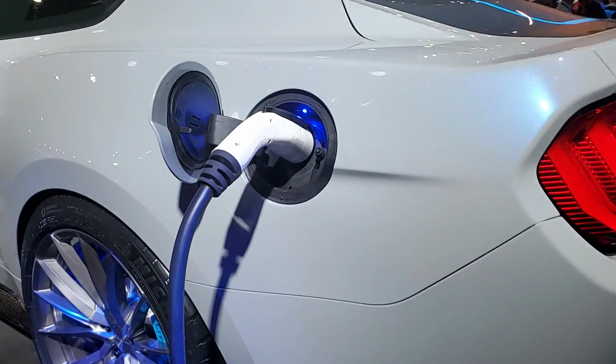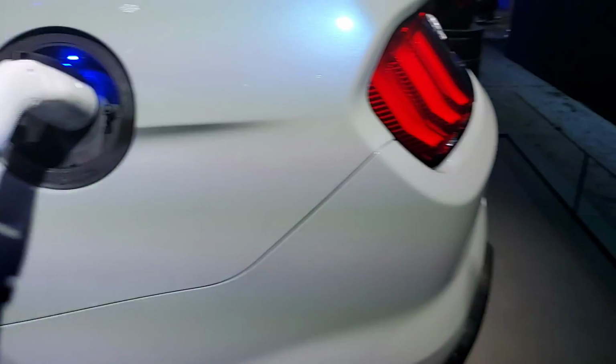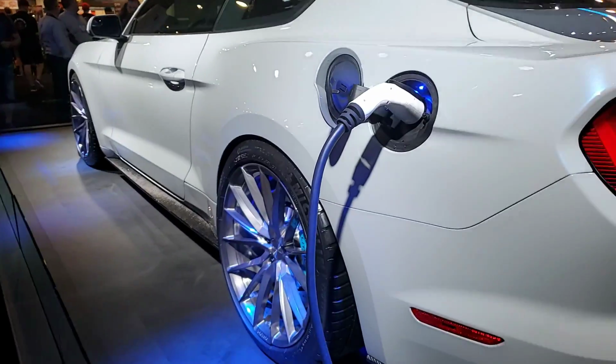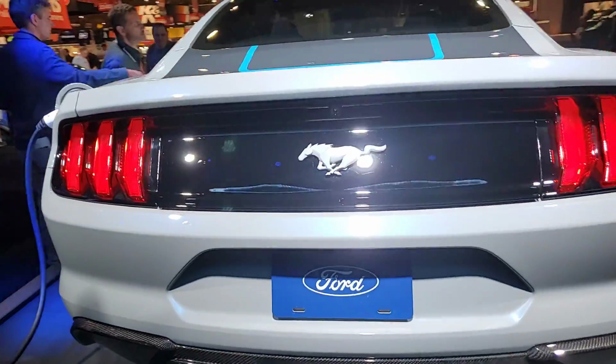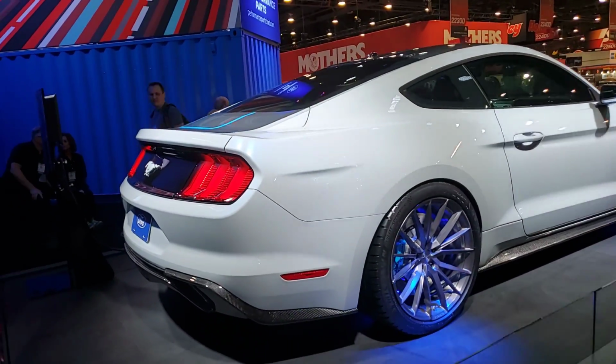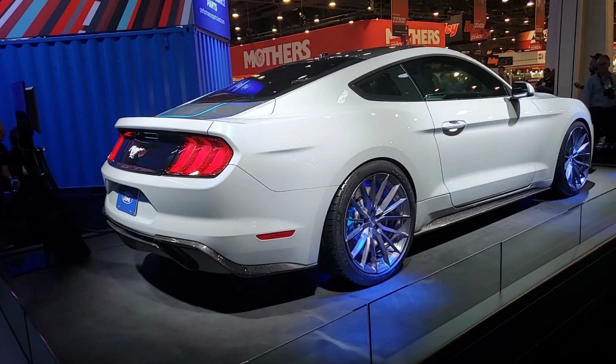For the OEMs. And why did you pick a Mustang? Because it would seem like 1,000 horsepower would be very hard to get down to the ground with only rear-wheel drive. Did you do the weight distribution in some interesting way to make that work? We did, yeah. By putting a third of the batteries under the hood and the rest over the rear axle, we're at a near 50-50 weight distribution. So it should be good on the track. Should be good. It hooks and it goes.